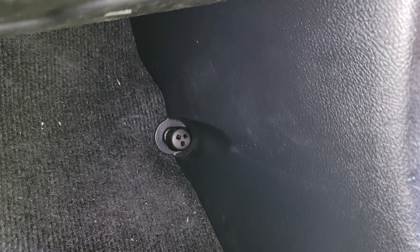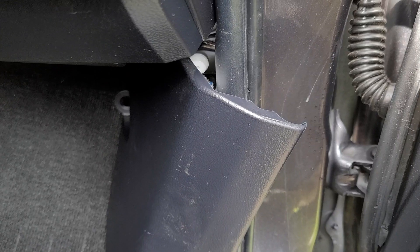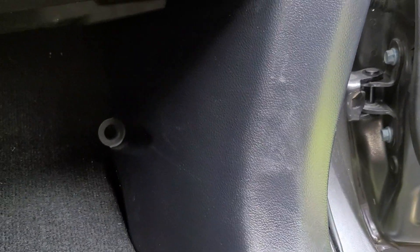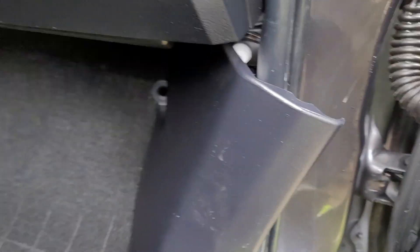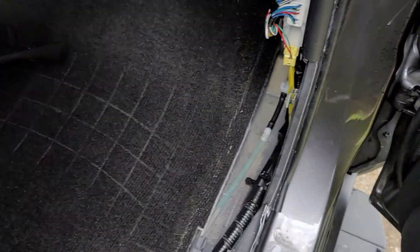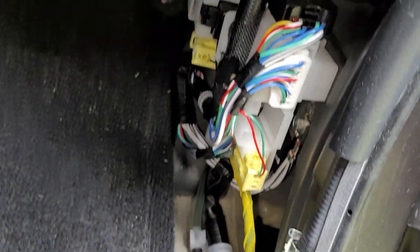They're really inexpensive, maybe $15 or $20 on Amazon. Lots of popular choices. I bought one just to help make things neat and keep from breaking components — using a screwdriver tends to mar the surface. So you just pull those door sill panels up, take that panel off, and you've got nice easy access to the raceways that are already there. You take that little button off, take the door sill component off, and that piece slips right out. There's not a ton that holds it in — maybe one or two snaps — and you can start seeing access to the channel.